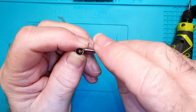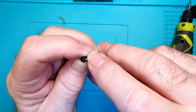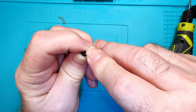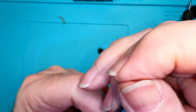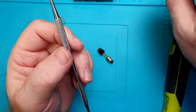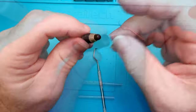This is a more modern pellet from a more modern diaphragm — the pellet isn't hard plastic, it's kind of a soft plastic. So I can sink that pick into it and pull it out. There it is. That tells me again that this was a modern sack with that little soft plastic pellet in it, and it is now ready for a new diaphragm.